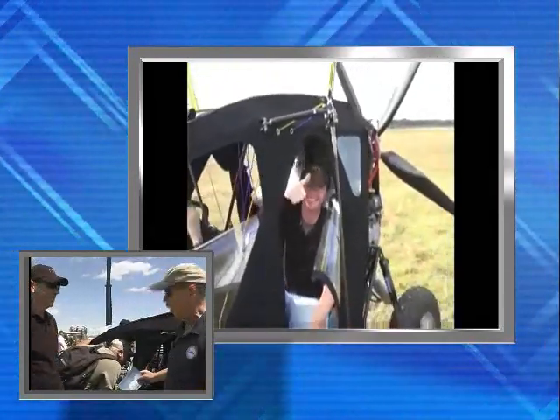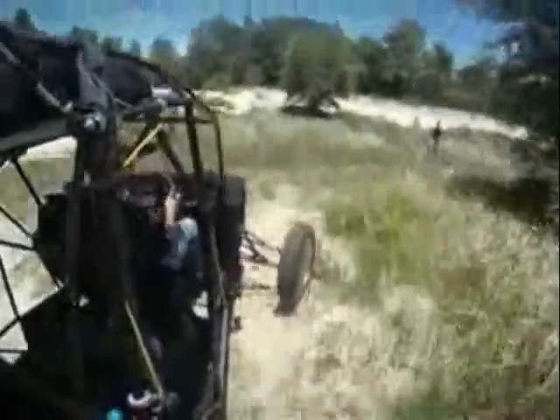Tell me a little bit more about the basic concept. You're using an elliptical wing, as opposed to the more square wing that's common in powered parachutes. And you do that to get a little more speed out of it? That, and a lot more lift for a smaller wing. An elliptical parachute is a lot more efficient in flight. We figure if we put a square wing on this, it would be close to a thousand square feet. We can put — what is the square footage of the one you use? It's about 520 and it's a full elliptical. A typical powered parachute uses about a 550 square foot square wing. In elliptical, that's about a 300. So the efficiency versus square means if it had to be the right size, it'd be 800 or more — just too unmanageable.